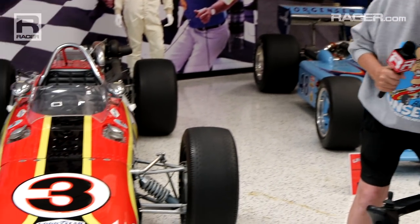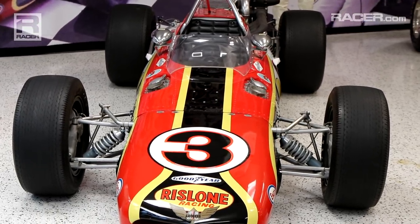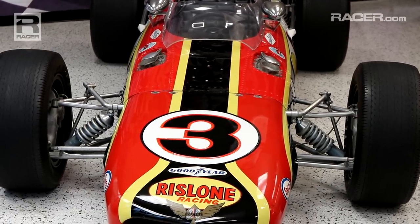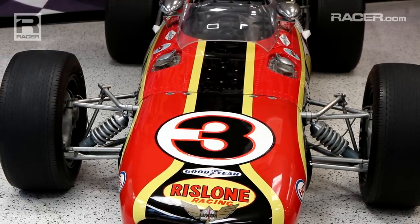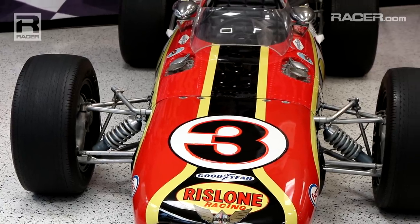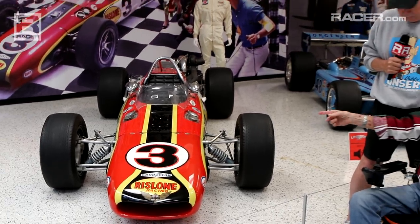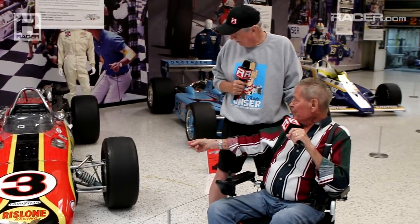We only had two mechanics instead of 500 — Red and Judd. So tell the people here, what does that do? Well, what it does is it loads the right front and loads the left rear. A lot of people that have watched sprint car and midget races have seen a guy carrying the inside left front tire around the corner — it's what I did here. I just made it like a sprint car or midget because that makes it like a live axle and preloads it, because they didn't make a sway bar any bigger than that and there was no room to put it in anyway.